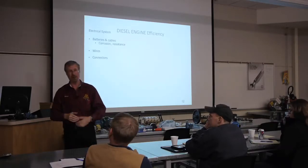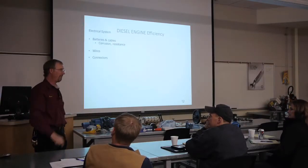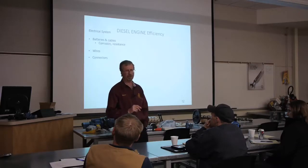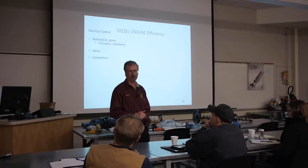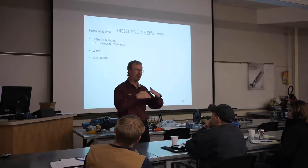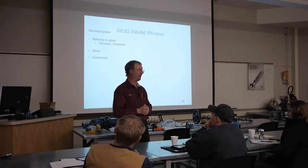And I can guarantee you, we can go out to the parking lot right now and we can look at a whole bunch of different vehicles. I can guarantee you a bunch of those locks are broken. All right? The kicker is we need to replace those connectors. You can replace those connectors without replacing wiring harnesses and all that good stuff. You got to have the right tools, and you have to have a lot of patience, all right? Because those little metal terminals have little locking tangs that hold them into the connector. And trust me, they are a bugger to get out of there. They really can be done, which is where patience comes in, all right?